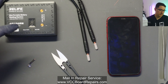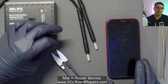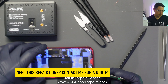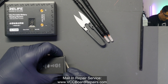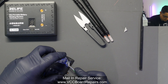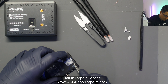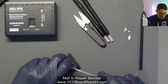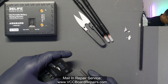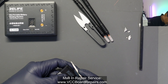Those ceramic scissors are not conductive so you can safely slice through. If you're a repair shop, you should have all the necessary tools already. If you're a DIYer, I don't recommend you try this yourself. So let's get started — we have battery health shown here, so let's get the battery out. This battery I had already removed so it's easy to take out of the frame. The goal here is to peel off these stickers. Be careful with the flex and make sure you watch the whole video — you don't want to skip a step and lose the battery health data forever.